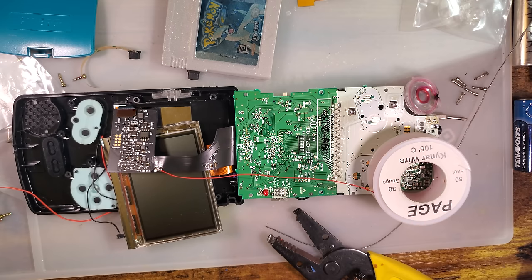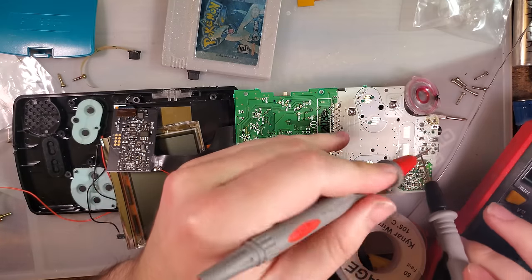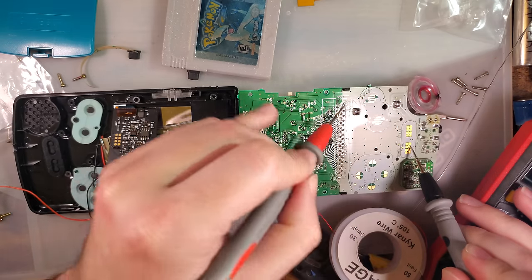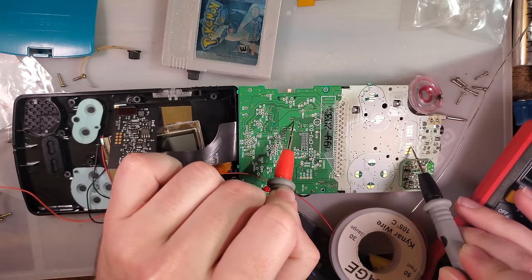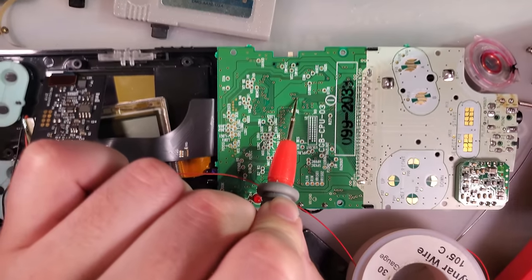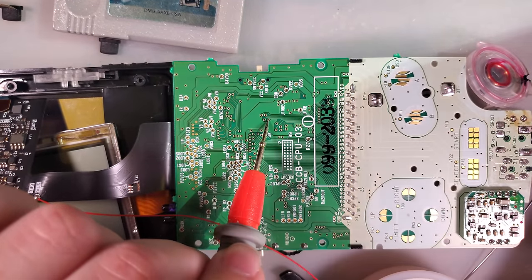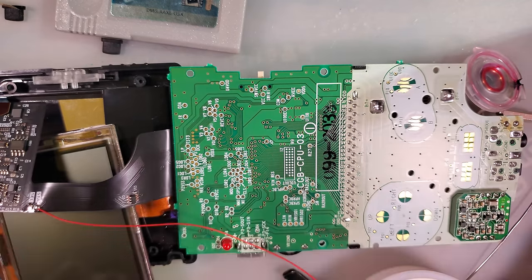Alright. I forgot which is which already. So let's beep it out. So that is select, probably goes to one of these four vias right here. Yep. Select goes to this bottommost of this cluster of four. Bring that in a little. Oh, my camera rig's hitting my light. But of those four little vias right there, select is the bottom one.